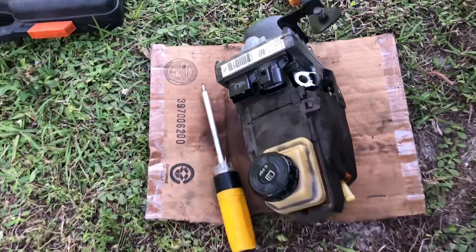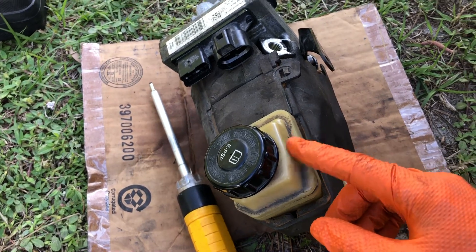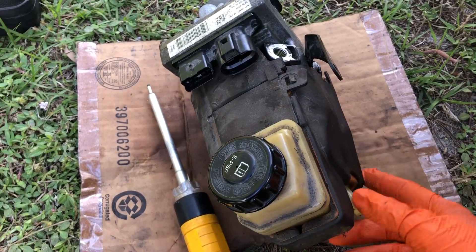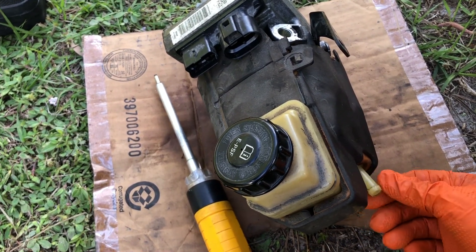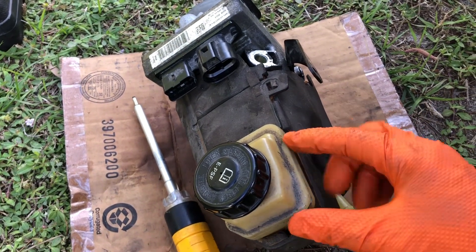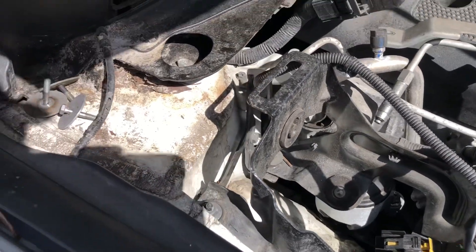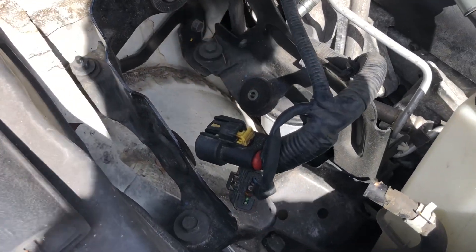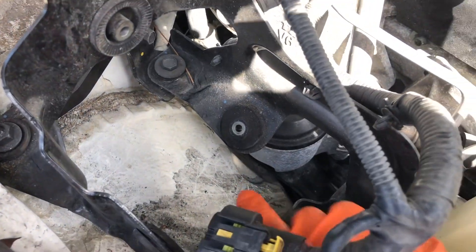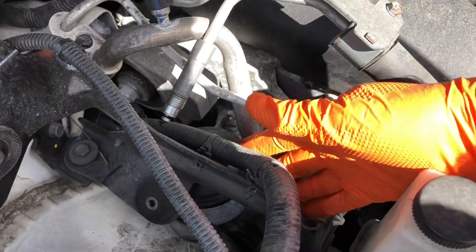Okay, so it's packed together, kind of almost. I want to put some power steering fluid in it to test it before I put it in, see if it still leaks at the bottom. So probably I'm going to take this back off, put some power steering fluid in it, and make sure it's not leaking. I vacuumed everything - that's how it looks. Like I said, that was the hardest screw to take out from here because you don't have too much space on the side.